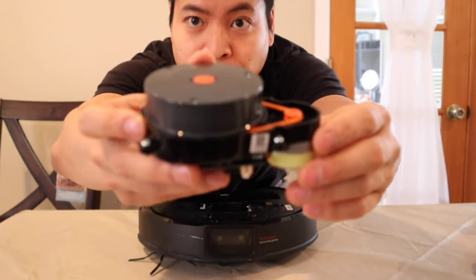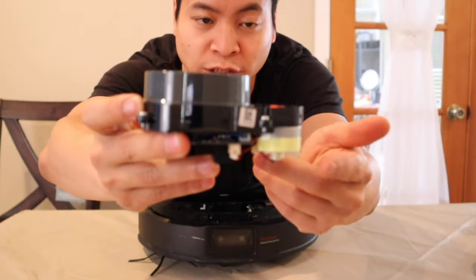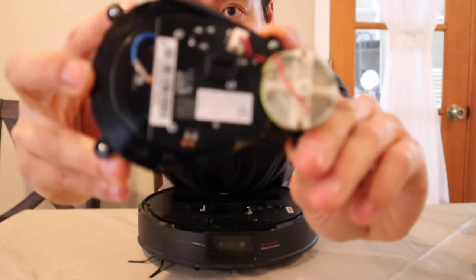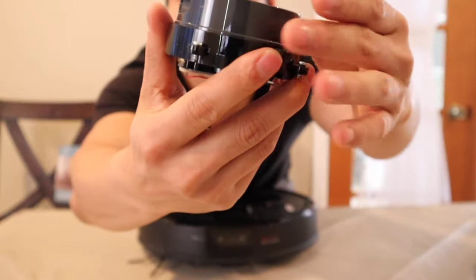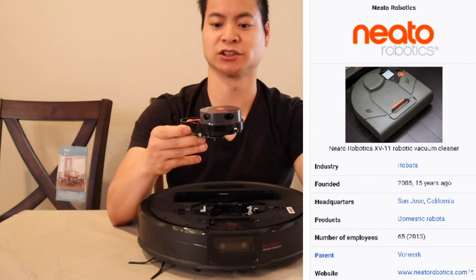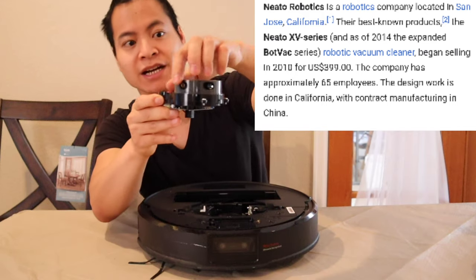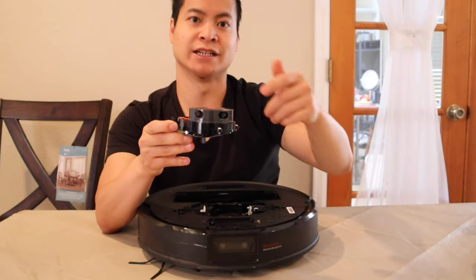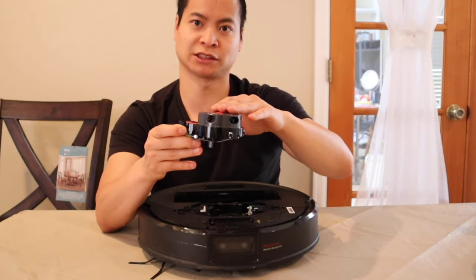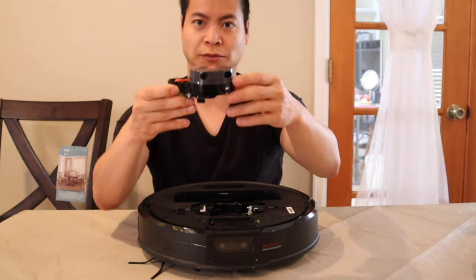You may notice that orange band — that's actually a belt-driven system. There's the drive motor and there's the LiDAR sensor. For my original S5, the actual motor burnt out — I believe it was the brushes. I could have replaced the motor for like 50 cents, but instead I bought a whole unit for about a hundred bucks. The first manufacturer to come up with LiDAR-based navigation for robots was Neato — about five or six years ago. These are angular-based LiDAR sensors: it shoots out a laser from a projector, a receiver detects the angle where the laser bounced off the object. This is different from a time-of-flight sensor, which measures how long the laser takes to return. They use the angular system to keep the price down, and Neato was the very first robot vacuum manufacturer to include that. I really like these LiDAR sensors.